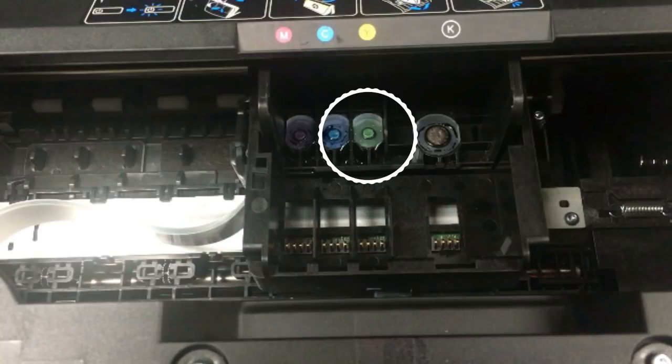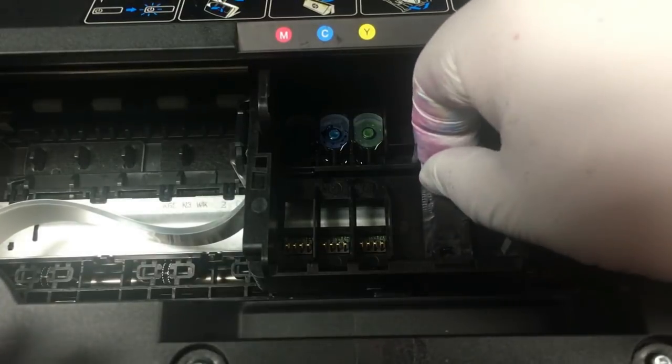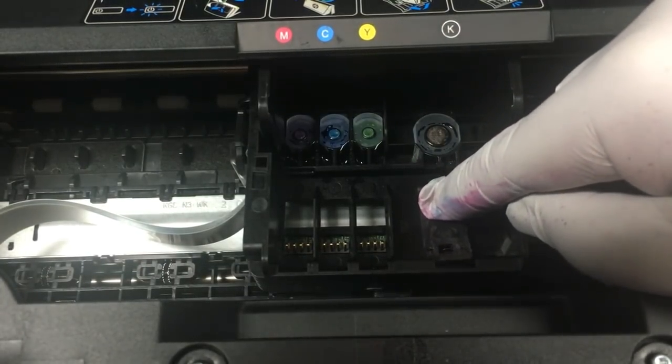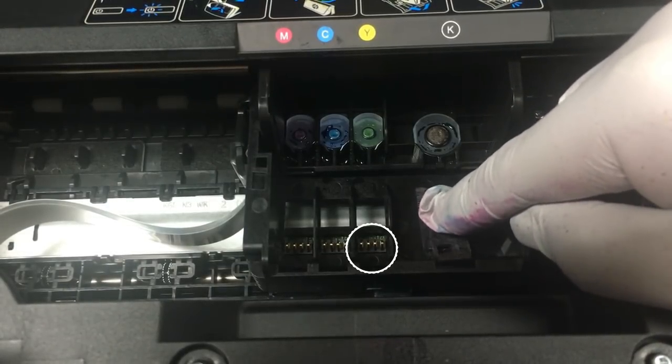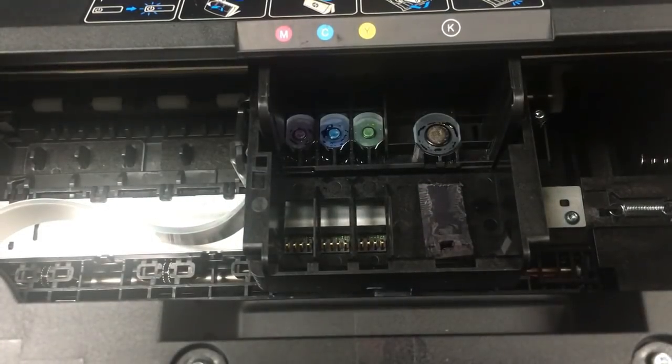We have a silicon washer installed. The installation is simple. Have the washer's short side pointing towards us and the longer side pointing towards the printer. Lay the washer on top of the ink intake and press it down gently. There are four brass pins on the printer. We need to let these pins have contact with the four plates on the chip.